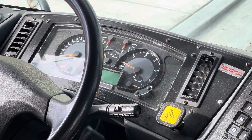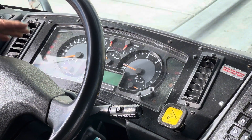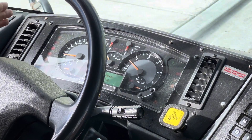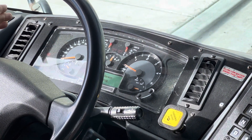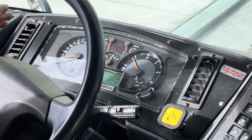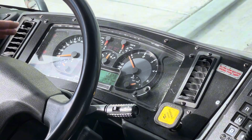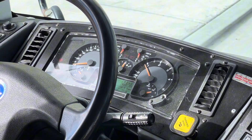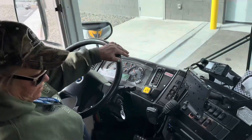We're now going to turn our bus off. Let the gauges calibrate. The ABS light has gone on and off. It's now safe to start our bus. So while our bus is building back up to air pressure, I'm going to go back down and I'm checking my flooring.